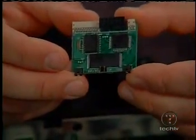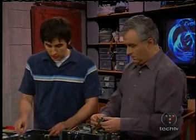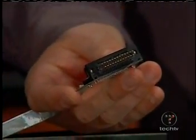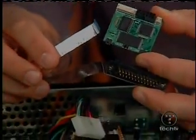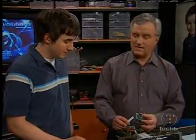Some companies are selling them without the software on there. This one here is called the Executor 2, and this adapter allows you to flash-program it through a parallel port. This goes to the parallel port, and this plugs onto the chip. Then where do you get the software you're going to flash on there? You have to find it in newsgroups or different forums online — that's the underground part of it.